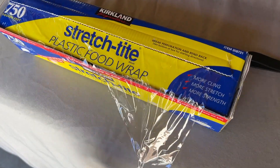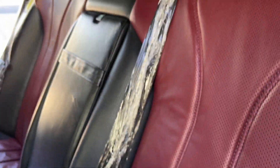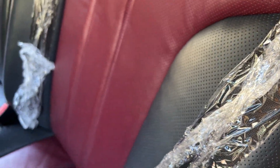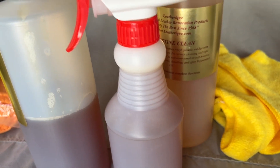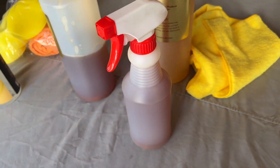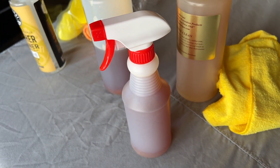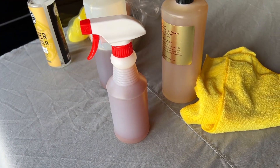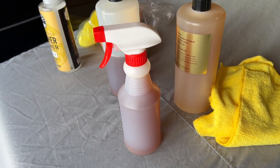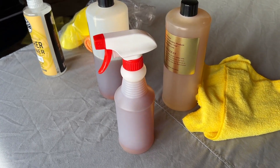I used plastic food wrap to cover all the seat belts front and back, to protect them from the Rejuvenator Oil. I filled a spray bottle with about half of the Rejuvenator Oil. I'm going to put on some gloves and apply it with my hands — they recommend massaging it into the leather for the best results. You want warm weather, about 80 degrees. My car has been in the sun for the first half of today, so the inside is really warm. I parked it in the garage, and the heat from the engine will stay inside and help the Rejuvenator Oil soak into the leather.